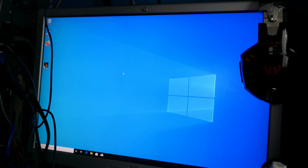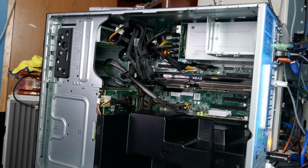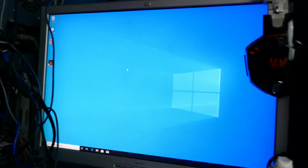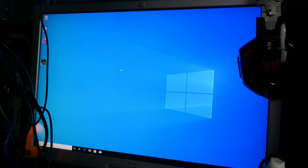Well, after Googling and coming across Dell's message board, a lot of people having the same issue with this thing, I now have a GTX 980 running in the system. What was the problem? Some people did say that there was a bug in the UEFI BIOS on this thing, and that's where I was leaning too, but as it turns out, disabling MMIO, memory mapped IO for PCIe in the BIOS is what fixed it, because it's supposed to allow PCI devices to remap that 4 gig memory thing, blah blah blah. Disabling that fixed the problem.